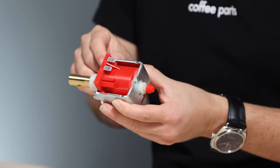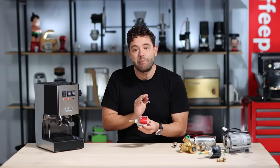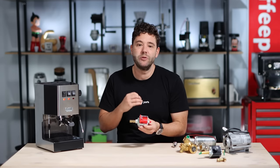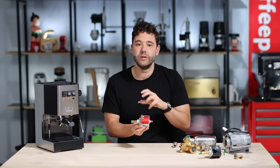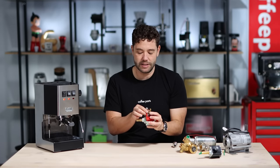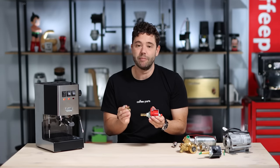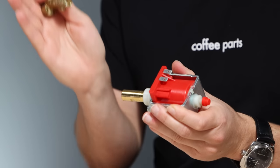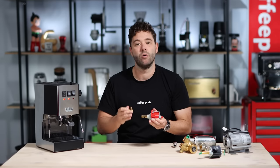Basically, you've got a piston that runs along inside a coil. There's a magnet on the piston. When the coil gets current, the piston goes back and forward, basically pulsating the water through the outlet of the pump — up to 60 pushes per second. With vibrating pumps, they only operate at one pressure. So to control that pressure at the group head, what we normally do is use a bypass valve. A bypass valve sits post the pump. The pump pushes at a stable pressure, and then the bypass valve removes some of that water back into the water reservoir, effectively bringing down that pressure to whatever you want — call it nine bars.